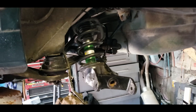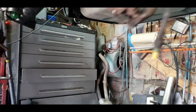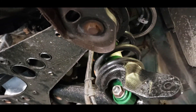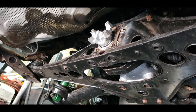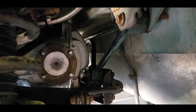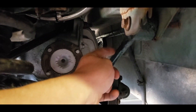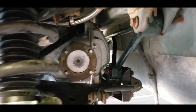Amid a power outage, my buddy Jeremy and I got the axle up into the car and ended up putting new Bilstein shocks on it — just stock replacements for the sport model. With the 95 to 97 axle, the pickup points line up fine if you use the 95 to 97 lower and front brace. The rear brace — the 98 to 2003 X308 version — is a lot stronger than the earlier version. The earlier one just uses a bar as a support without any gusseting or loop, so the newer style is considerably stronger.